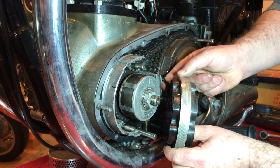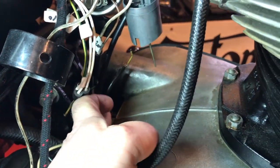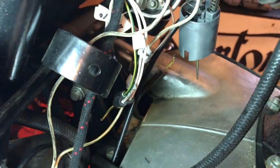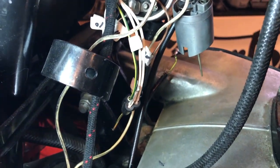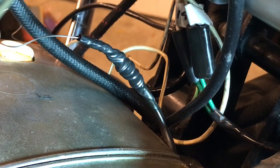Before I start pulling it through, I'm going to tie something at the other end and make sure it's nicely lined up to draw out through this hole. Here on the other side where the wires have broken, you'll see the wire just disappears under the chain case casing. I'm not sure how confident I am in just pulling that wire through, so I'll attach another piece of wire to it and then pull it through. We'll see if that works — it might be a little too wide to go through the hole, but I'll try.